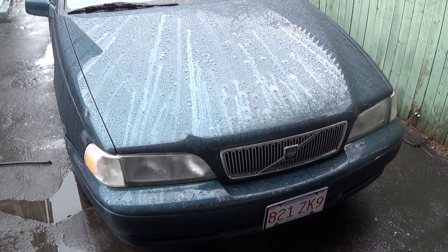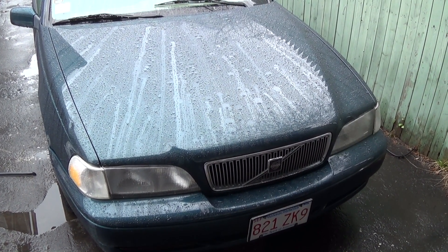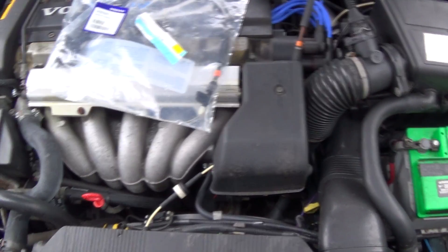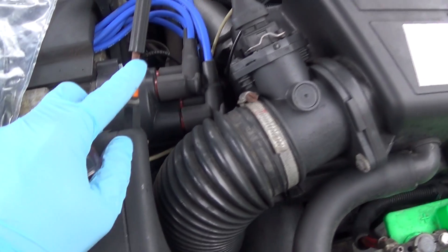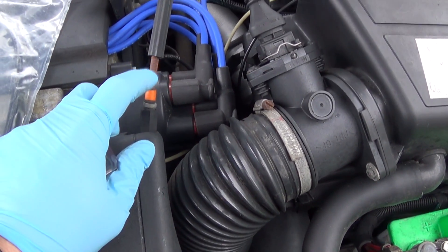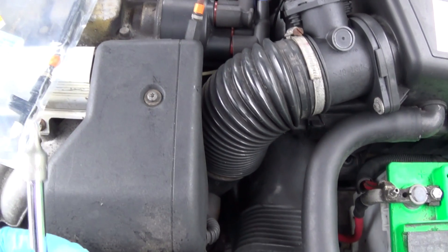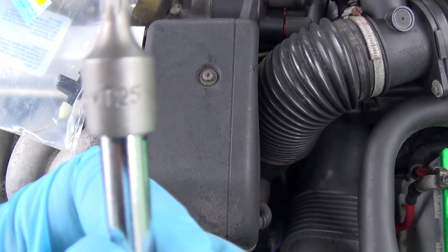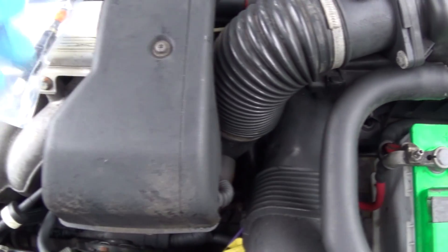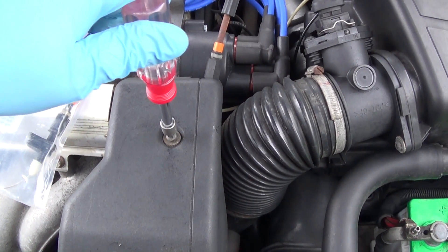The first thing I'm going to do is pop the hood, and I'll show you how to disconnect the throttle cable under the hood. Here we are under the hood, and here is the old throttle cable — you can see the housing is not in the greatest shape there. In order to access it, I'm going to have to take this cover off right here, and it looks like a T25 bit to do that. I'm going to get this cover off and I'll show you what to do next.